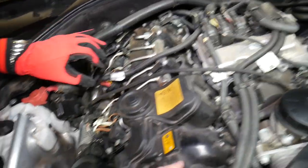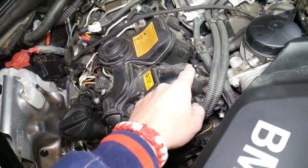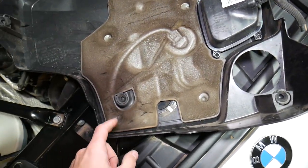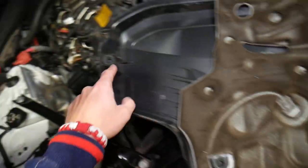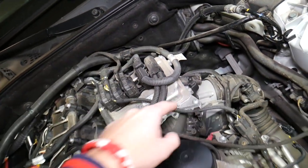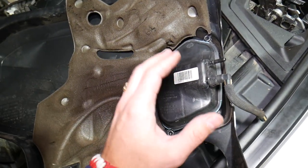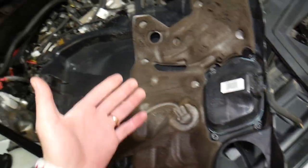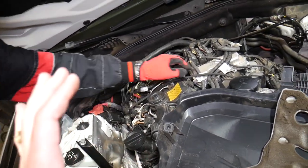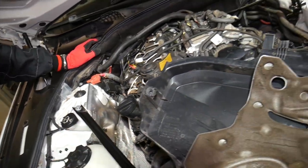On the front, you have two bow clips — one here and one over there — that attach to the front side of the engine. You also have a third one that's located all the way at the engine computer. Those are all the clips, and that's how you remove the cover. Be careful with the vacuum lines — you have to connect everything back, otherwise your car will not perform right and you may get a code for a vacuum leak or turbo problems, because that's the turbo vacuum boost solenoid.